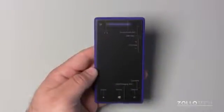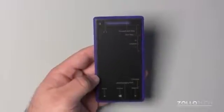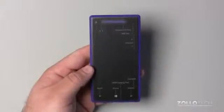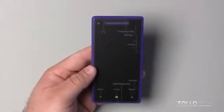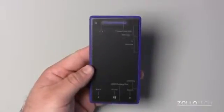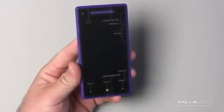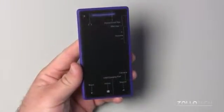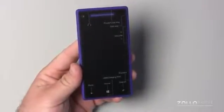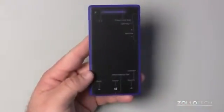The phone itself has some pretty impressive specs. It has a very nice 4.3-inch 720 by 1280 display — so 720p. One of the more impressive things about it is it's 342 pixels per inch, which is more than an iPhone. We've seen that in the Lumia 920, and this phone beats the iPhone 5's 326 pixels per inch by a few.